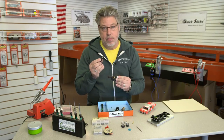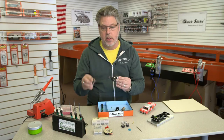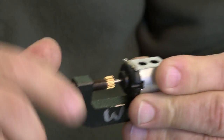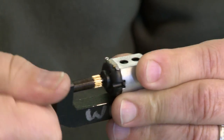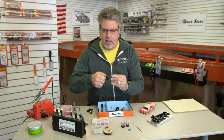I need enough space to pull the pinion back if I need to — I just need some gap in there. I want to get it close, but not too close. Maybe the thickness of my flat blade screwdriver. So I've got it close there.